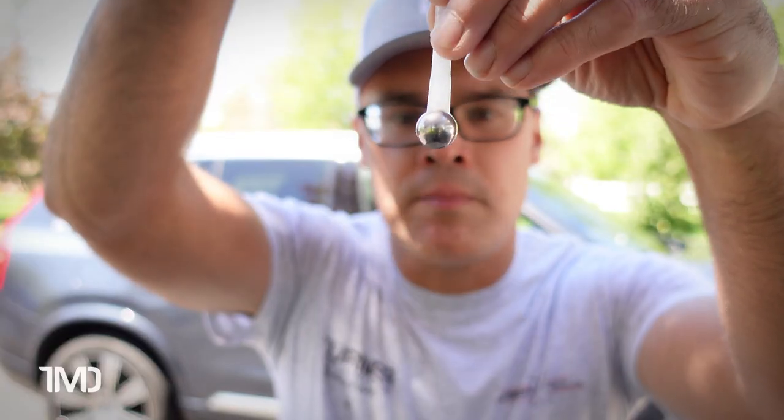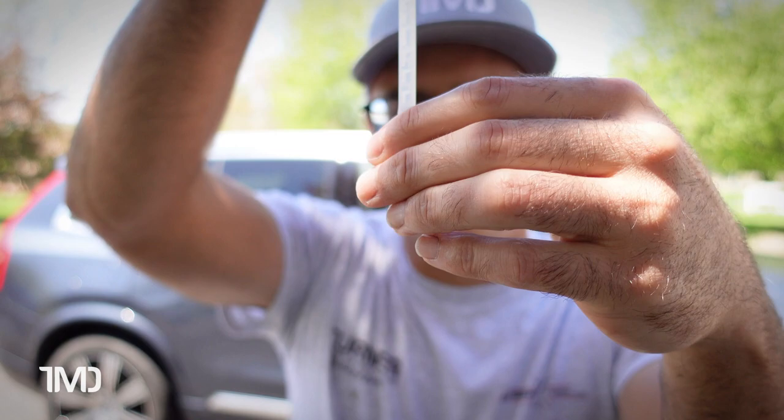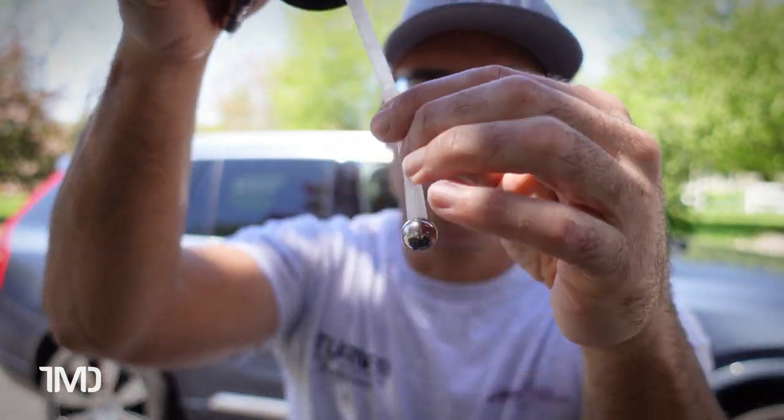It's a week later. I reached out to MJJC and a customer rep got back to me same day with a solution for the ongoing issue of watery, near non-existent foam. After replacing the filters we did see an increase in foam, but it wasn't back to where we wanted it. MJJC recommended cleaning the filter ball on the dip tube — I removed it, soaked it in white vinegar overnight, then reattached it. Let's see if that fixes things.